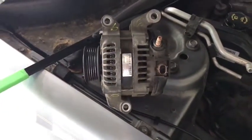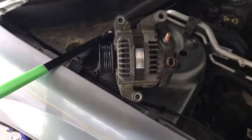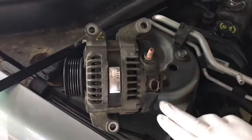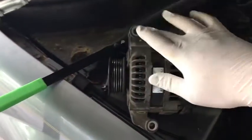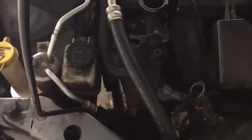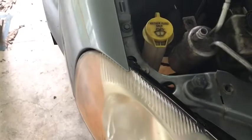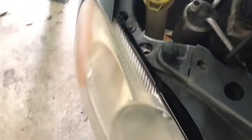This process is going to be pretty painless, though it's going to vary from vehicle to vehicle. In this case I have one electrical connection here, a sensor connector, and bolts one, two, three, and the pulley. Moving around to the front of the car, you can see bolts one, two, and three down there, and the belt hanging off to the back. I would literally just take the alternator, bring it forward, put it into that spot, get the bolts in place, and then get the belt pulled back over it.